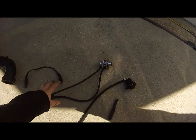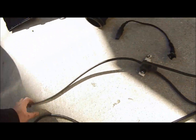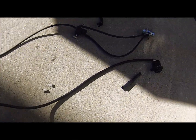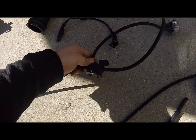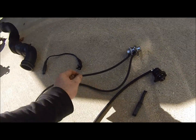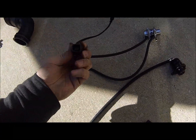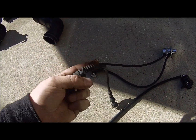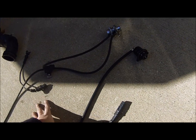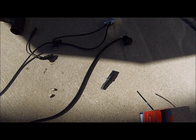This one goes to the recirc — this is the Forge blow-off valve vent to atmosphere, the same setup for the upgraded recirc. It comes right from the boost tap, just like this one. But if you notice, the TurboSmart — that's it. They get rid of this whole solenoid system here, which I don't understand why they would do that. TurboSmart has just replaced it with this — it's a bypass, that's exactly what it is. You can see the same thing here, and there's a lot of dry rot here because this is right by the turbo. The install is a heck of a lot simpler — just bolt it on to the turbo, plumb it back to a vacuum source, and plug that into your original diverter valve connector.